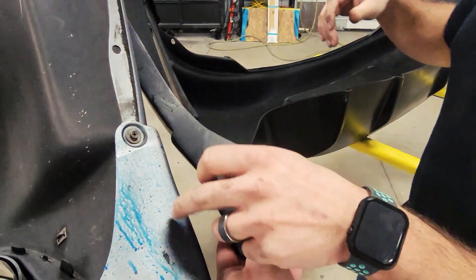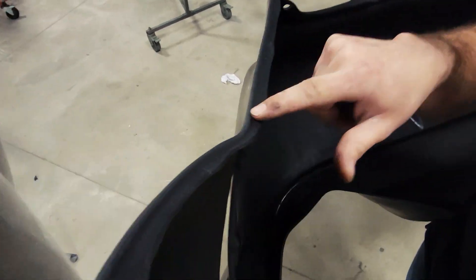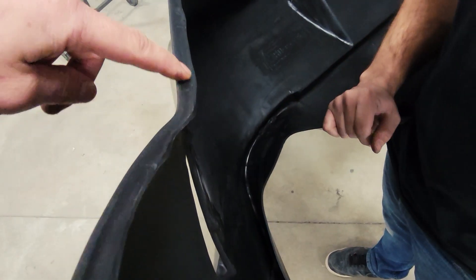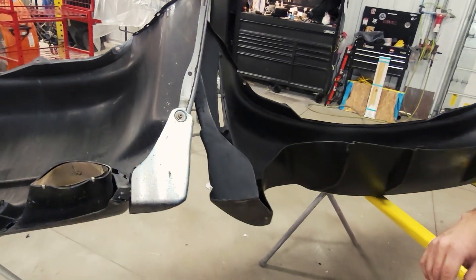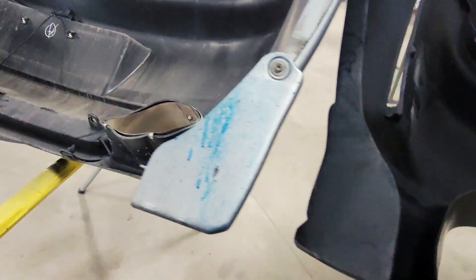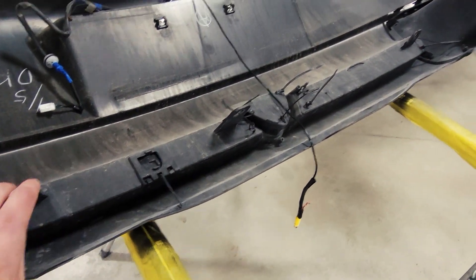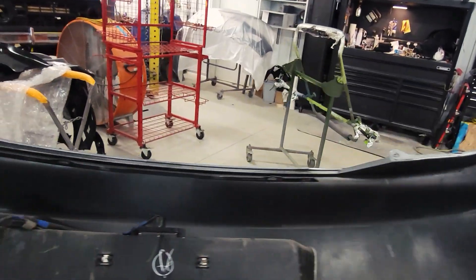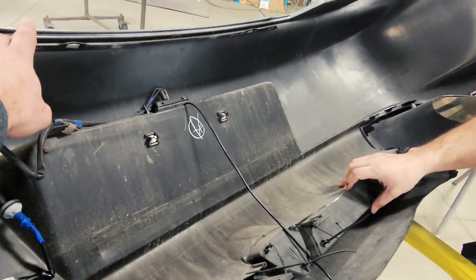Is this piece separate on this bumper? It's separate — all one piece on this bumper too. All these holes are not drilled out yet. We noticed as soon as we took it out of the box that none of this was here — they're all impressions. It kind of tells you where to cut them, but they're not cut. We'll probably have to shave it back some more because that line is going to run into the inside of the quarter panel. There are no mounting spots down in front, so those are going to be a fun one to figure out. There's actually a nice little bracket here to grab onto the body panel, but there's no support on the bottom of the bumper and no support on the top of the box bumper.